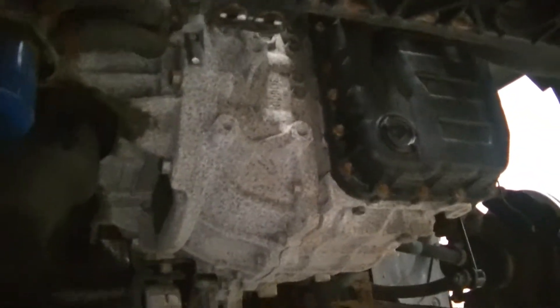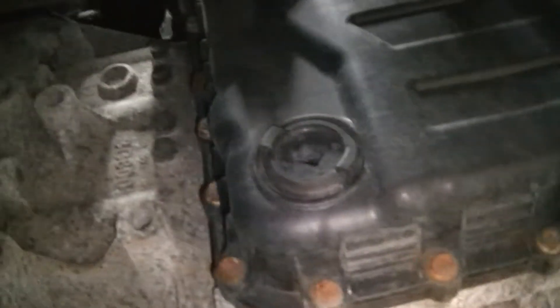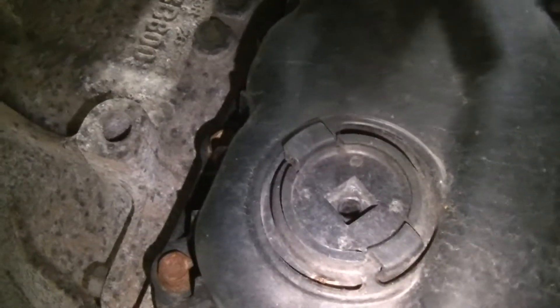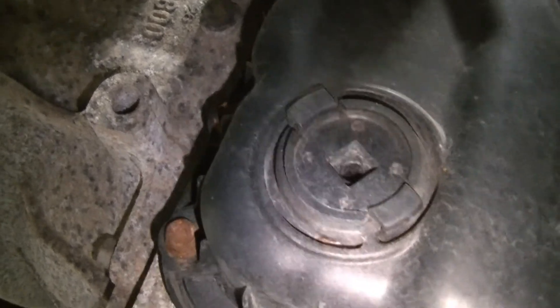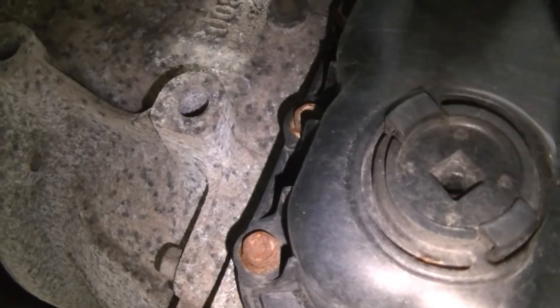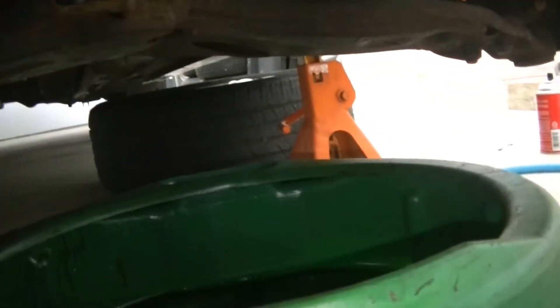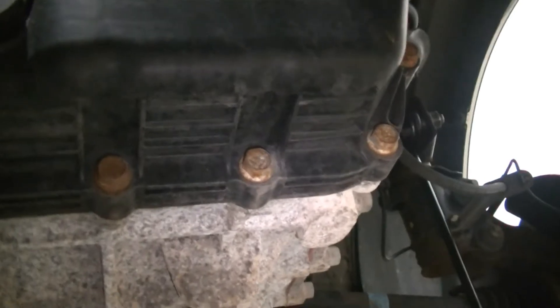Let me give you your bearings here. This right here on the front of the vehicle is the transmission pan. Behind that pan is the valve body. This little guy right here is going to be your inspection plate — that's what you pull out to inspect the transmission fluid level. This right here is our drain plug, and it is a 24-millimeter bolt. We have a 24-millimeter socket and ratchet here. We're going to crack that loose, take it off, and drain it right into this bucket. I'm going to show you what the magnet looks like when we get it out.